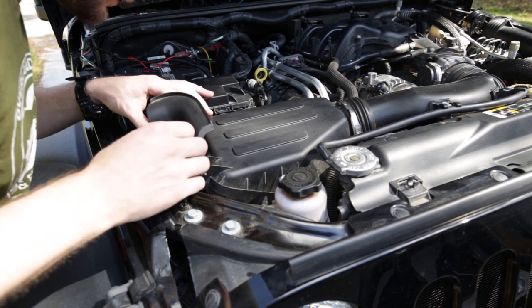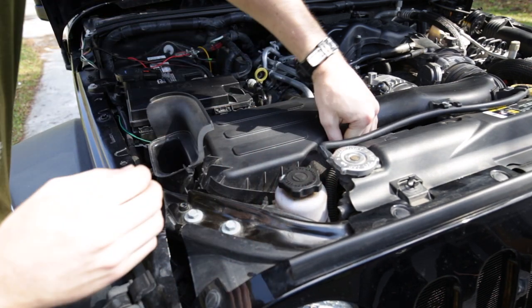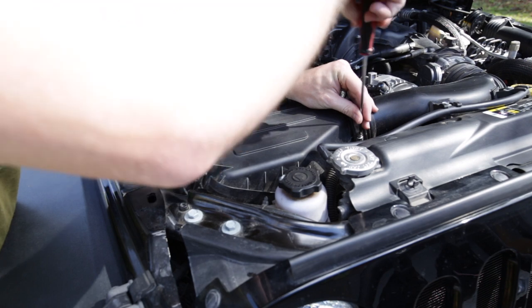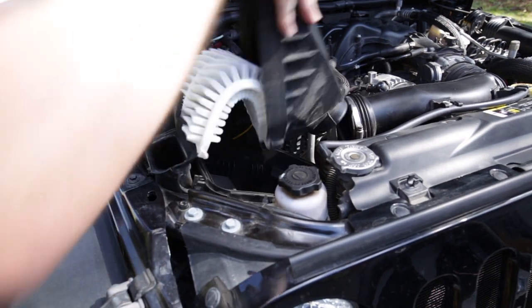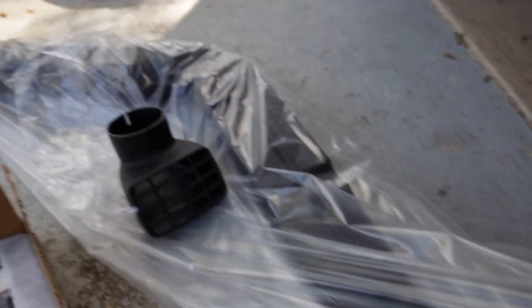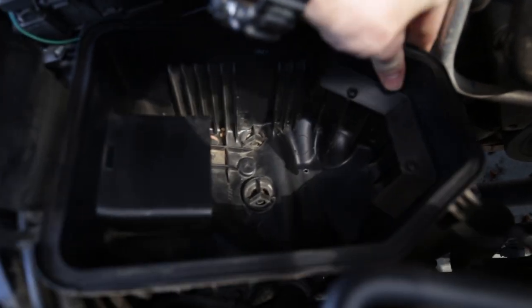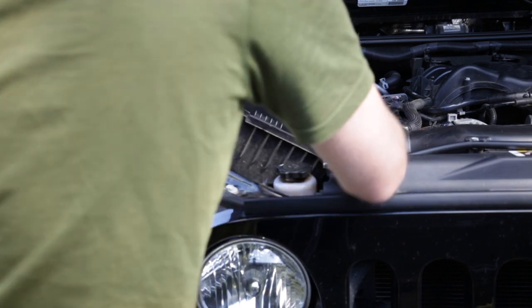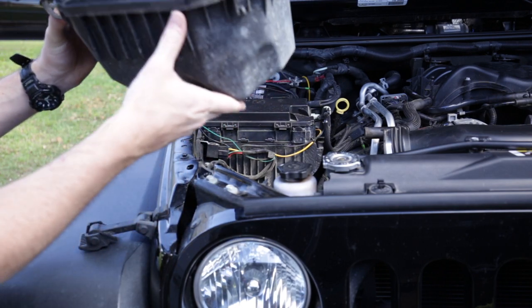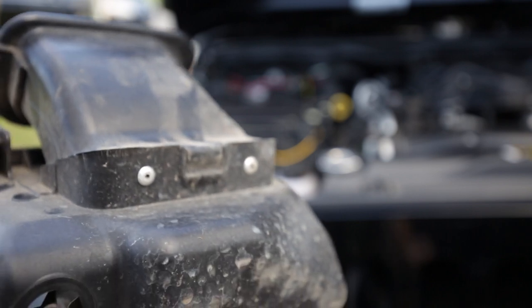We want to disconnect the air hose from the air box with a flathead screwdriver. Here's everything that AEV has supplied: we have the snorkel head, the actual snorkel system, a box of goodies from AEV, and some great directions. The next step is to pull out the air box — make sure to pull straight out so you don't pop the legs off the bottom.